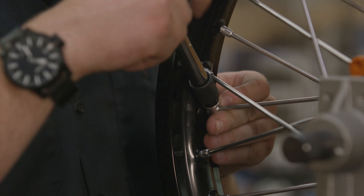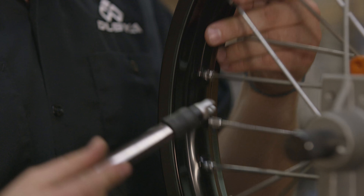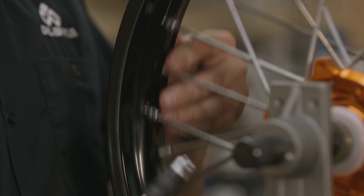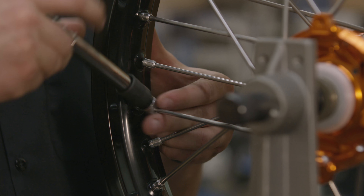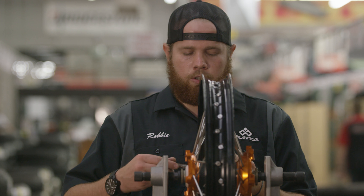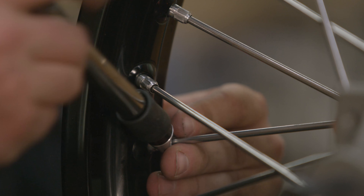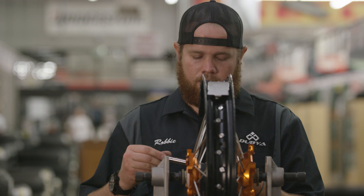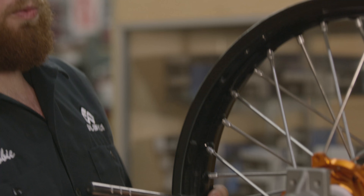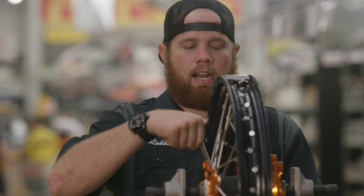Starting at that first spoke, give it a tighten. You never want to tighten more than a quarter of a turn at a time, maybe up to a half a turn if a spoke is exceptionally loose. Tighten that spoke a quarter turn, then skip two spokes and go to the third spoke, which will be pulling towards the opposite side of the wheel. Same thing — quarter turn — and just keep going to the next spoke after that. It's a good idea to always keep the previous spoke between your fingers so you know where you are and can track your progress. The reason for this pattern — starting with one, skipping two — is to limit how much you're moving the wheel, whether pulling it to one side or pulling the rim inward or outward. You'll end up going around the wheel three times, which will get all the spokes tightened.